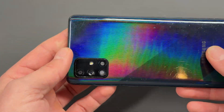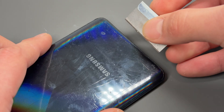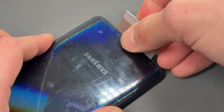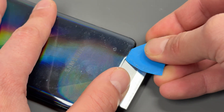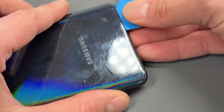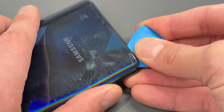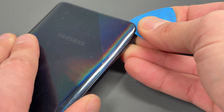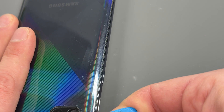To start off this repair you don't really need to use heat — these aren't stuck down too heavy. Just use a single-sided razor blade to create a small gap in the bottom of the phone. Once that gap is big enough you can insert a plastic guitar pick, and that's going to help you get into the adhesive. Insert it about five millimeters between the back cover and the frame and run it along the edges of the phone and it should come off pretty easily.